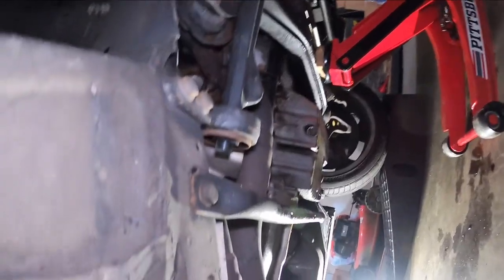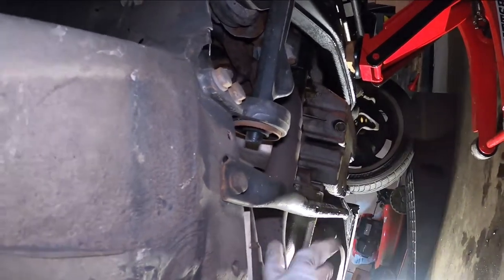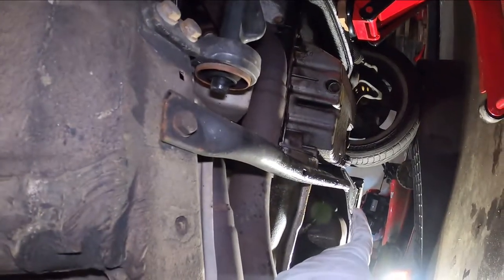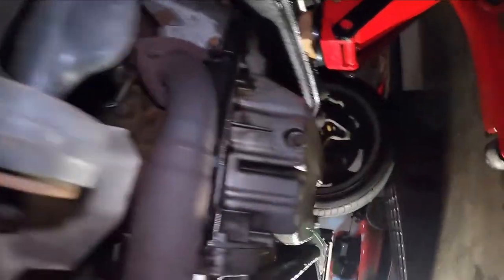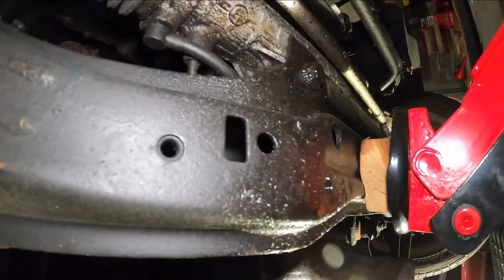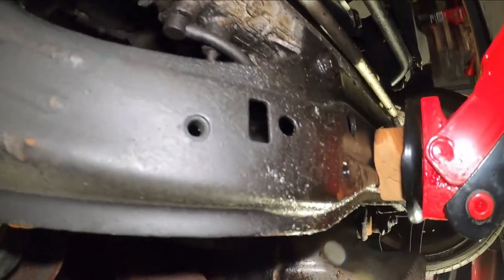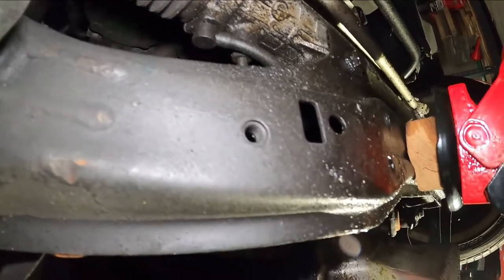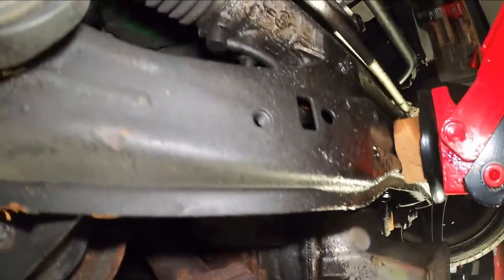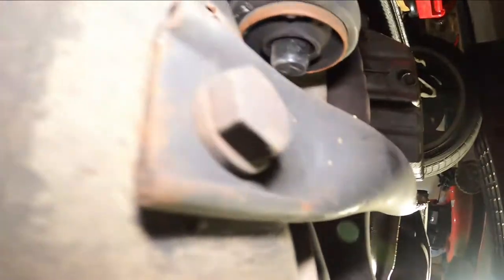I am now under the car. To install the x-brace we first have to remove this brace that comes on the M3 — there's one 13-millimeter screw here and one on the other side. The area where I have the jack — these are the two pre-drilled holes circled here. This is where the x-brace is going to go, and there are also two more on the other side. If you do not have these pre-drilled, you have to drill them. I'm going to put a link in the description for a kit to make sure you drill this properly.